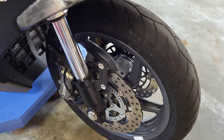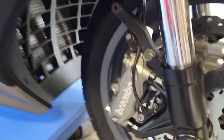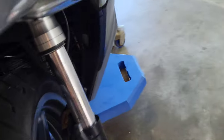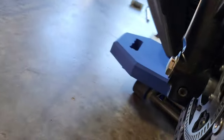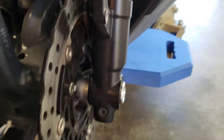These two bolts as well. After you get the front fender removed, you want to take off the speed sensor. You've got your two bolts right here for your caliper, same on the other side — you want to hang those up. Then we're going to loosen these screws right here, then pull up the axle. This should come out pretty easy.